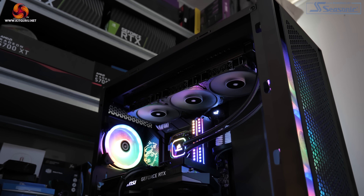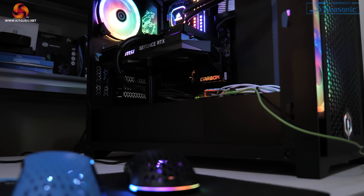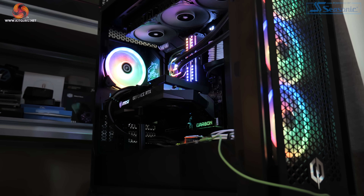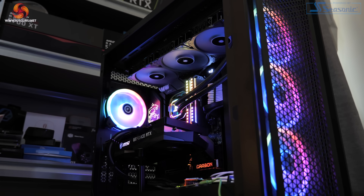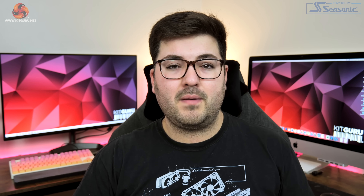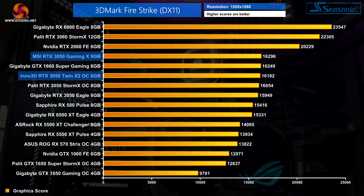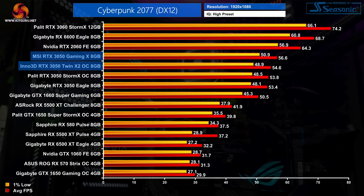That should give you a good feel for the overall designs of both cards, and now it's time to move on to our testing. All benchmarking was done on a GPU test system supplied by CyberPower, based on Intel's i9-12900K connected to an MSI Z690 Carbon WiFi motherboard, with 32GB of Corsair Dominator Platinum DDR5 memory clocked at 5200MHz. The first thing to almost get out of the way is the gaming benchmarks, since testing four RTX 3050s isn't going to produce any surprises. We'll look at 3DMark Firestrike and three other games. The reason we don't test more games for an AIB review is that no factory overclock is going to add more than a handful of FPS.